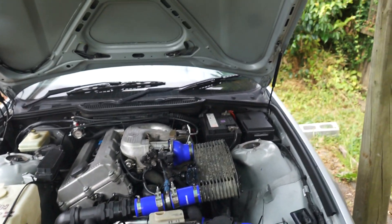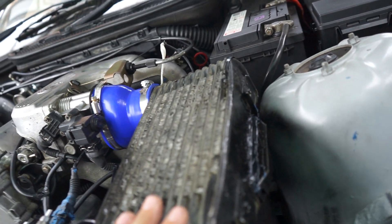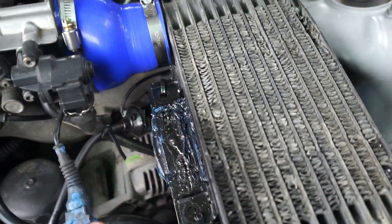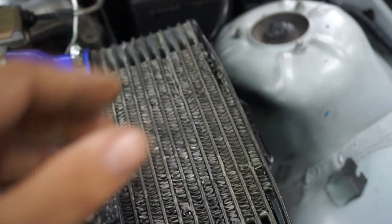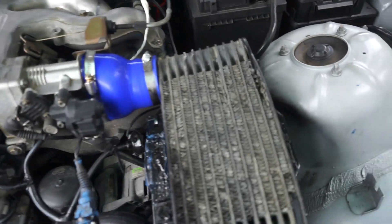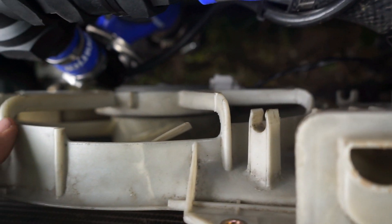For my intercooler — it's not mounted exactly where I originally wanted, which was in the front. I got lazy and it was running alright, so I grabbed a small intercooler from a Ford or something and bought a little radiator fan for it. That's wired into a switch inside the cab, and I made a small duct using silicone to direct airflow through it. I also had to replace the stock engine fan with a small electric one I found at the scrap yard — I believe it's from a Toyota Yaris.